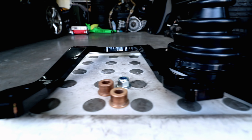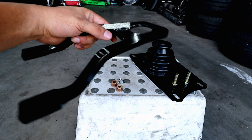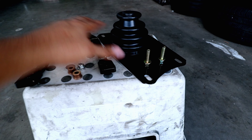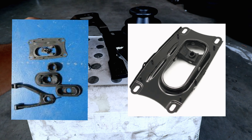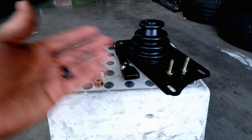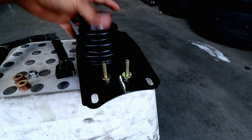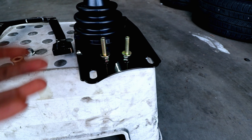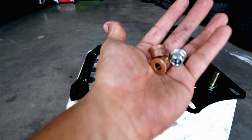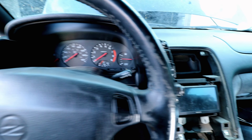What I have in front of me is the shift mount bracket from Concept Z — it's called the Z Performance Mount Bracket. I'll leave it linked in the description. It has very solid construction and replaces the stock bracket that has a bushing in the middle, which can break over time — and when it does, you have to buy the whole bracket. It also comes with a plate to seal up the transmission tunnel, hardware, and a new boot. I also bought some brass bushings for the shifter, which should be better than the stock ones.